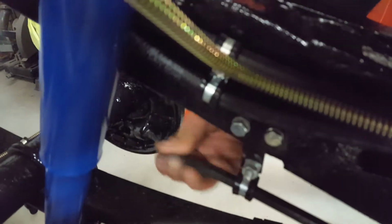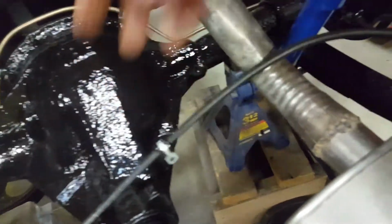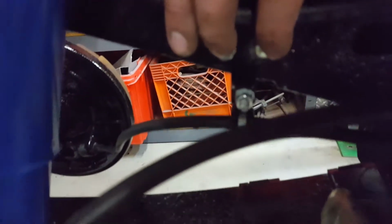And also, since I left you last, this parking brake cable that goes to this driver's side rear was riding on this muffler here. I didn't like it. There wasn't enough slack to bring it up and tie it up to the body like the passenger side one is going to do. Here's the clamp. It's going to go right up to the bottom of the body. So I fabbed up a piece of metal here, T-shaped, drilled and tapped 2 holes, if we can focus here.